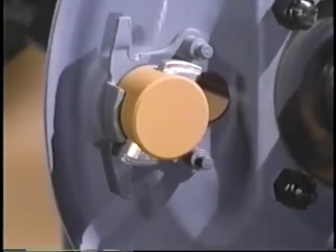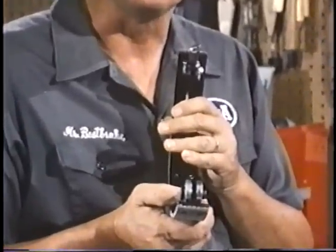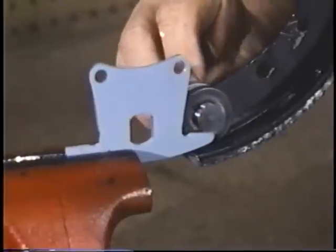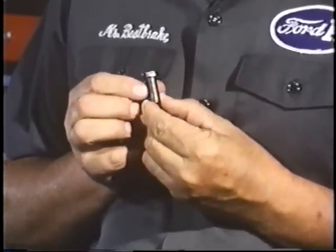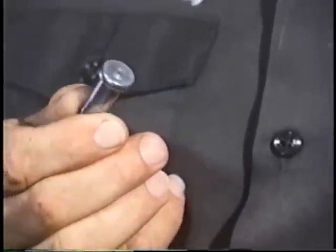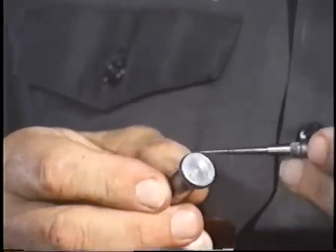The cam fits in the end of the camshaft, and when the lever is pulled, the cam forces itself into the rollers on the brake shoes. Next: the rollers and the roller pin. Rollers are not too much of a problem — they were hardened parts, and a big percentage of the originals are still good. Reproduction rollers are prevalent and some are quite good. But the roller pin is another story. It rides on the brake track and therefore should have a flat machined edge and be perfectly round. Most of the originals are worn, both the head which rides on the roller track and the shank which pins the rollers to the brake shoe. The reproductions are absolutely terrible — they are not machined, they are a swaged part which bears little resemblance to the original. Typically they are out of round as much as 20 or 30 thousandths or more.